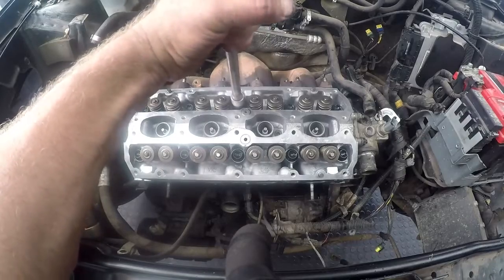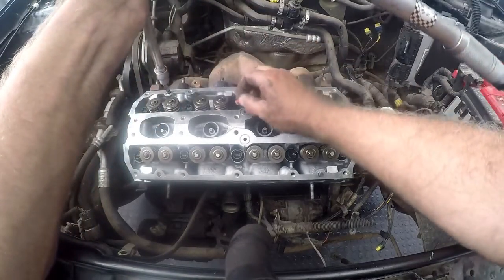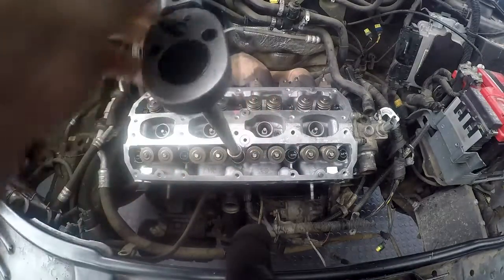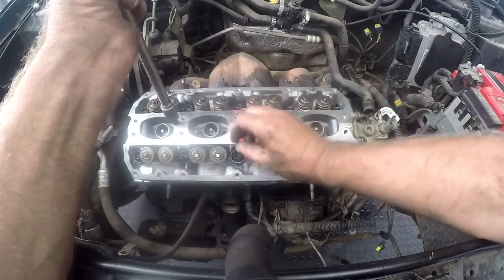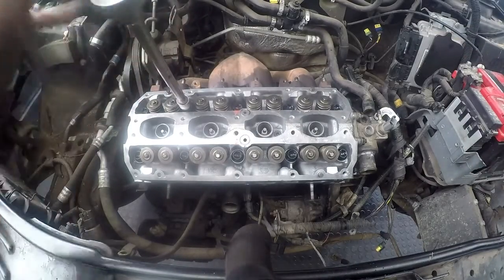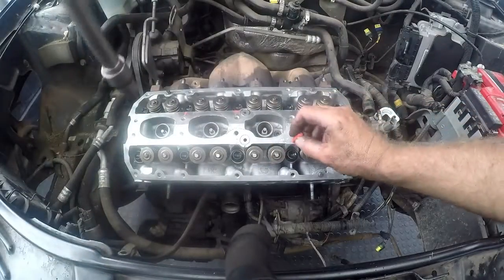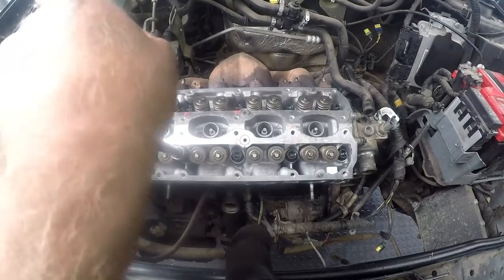I'll turn it up straight like that and turn it until I have my 90 degrees. Then I mark that bolt so I know I've already tightened it and don't tighten it a second time at the same stage. So we start there and end there — that's 90 degrees — and we mark that one and go on to the next. Remember: from inwards outwards. We've got 90 degrees on that one and the opposite 90 degrees on that one, so let's mark those two.